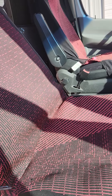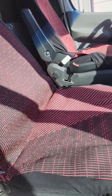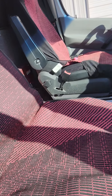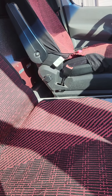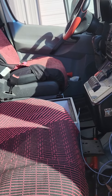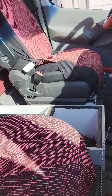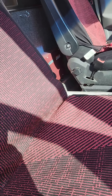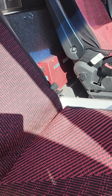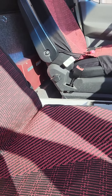When you're plugged in you're going to be charging your house batteries. At some point in the future it would be worthwhile to look into an auxiliary start — a bridge between the two battery banks. It would be fairly simple and inexpensive: just a momentary switch with a relay that would bridge the start battery with the house batteries, since the house batteries have the solar panel charging them, the alternator charging them, and when plugged in the converter can charge them as well.